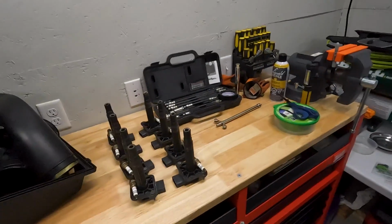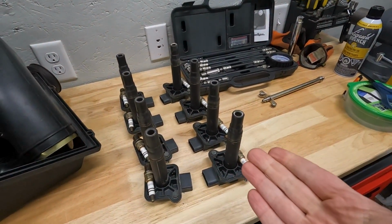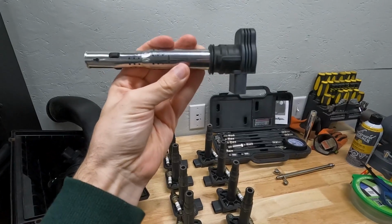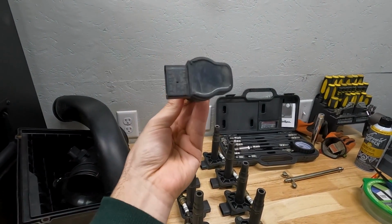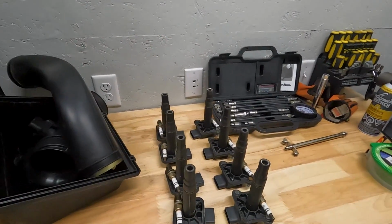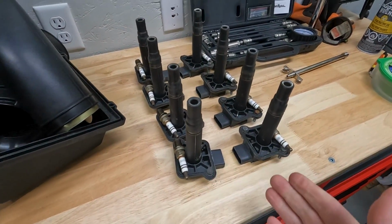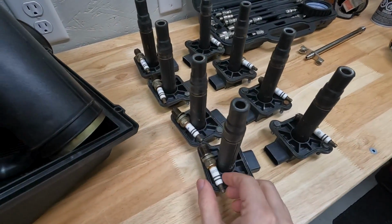I have pulled the plugs and packs. I've got the fuse in the passenger footwell taken out for the fuel pump. And then I've got my battery out in the trunk all charged up. And I just wanted to show you what came out of here. So we have the old style packs. I think they're called ICMs, which is a departure from the FSI style ones that you're probably more familiar with. I am too, but not that I really know what to look for if these go bad, but you know, they're not cracked. The condition looks good. I don't think there's much of a concern there.